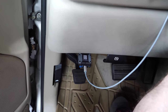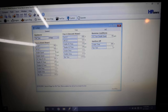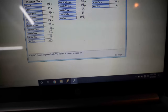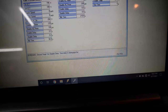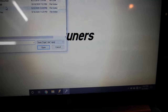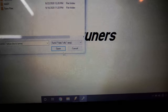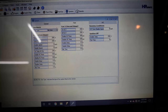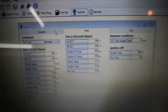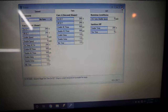So I have HP Tuners plugged into Tahiti. Let's turn the key on. All we're going to do here is flash over a modified tune file. If we go into System, these are the settings I'm going to use to get the fans to work. If I open up the stock tune file that I ripped off Tahiti's computer, you'll see the fan type is set to 'no fans' and all the numbers are maxed out — it doesn't do anything. That's why once you hook everything up the fans aren't going to work until you come in here and change this.